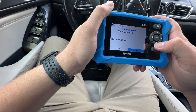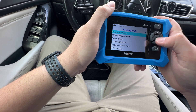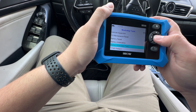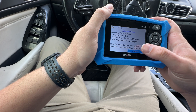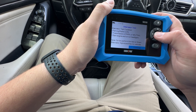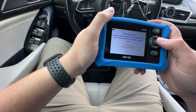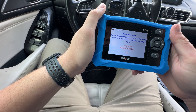Under workshop tools I selected a 2018 Mazda 3, four-cylinder 2.5. Options include vehicle inspection, oil maintenance reset, battery reset, battery initialization, and battery and alternator test. The vehicle is already running with parking brake on, transmission in neutral. It says: start the engine, turn on the headlights, do not perform the test on a smart alternator, hybrid, or electric. You have to bring it up to 2000 RPM.